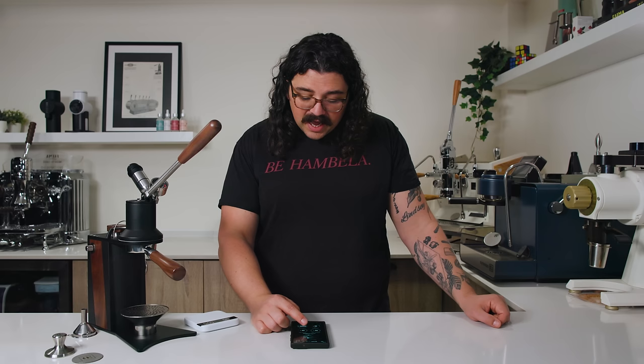which is the boiler temperature. Now the boiler temperature, what is real time is that faint blue-green color. The red is the target temperature that is needed in order to give you equilibrium between the boiler and the group head, which the temperature is shown below, to hit your target temperature. So this sounds complicated, but all the complications are done here, you don't have to think about any of this. You set your temperature and you go. I've tested it and it is very accurate.